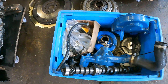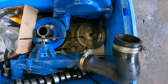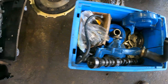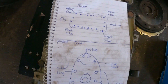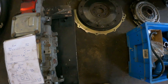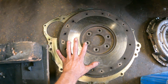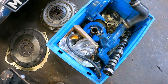Got everything boxed up and labelled up — everything's in separate bags. Organisation is always key. I've kept the chain all in the same place, although it does look pretty simple to time up. Got some little marks on the teeth. I've made a note where all the bolts go — where the longer ones and shorter ones are. The clutch is a bit worn so we'll put a new one on. Flywheel is absolutely massive — you can see why I had to make extra arms for the engine stand. Just colossal.